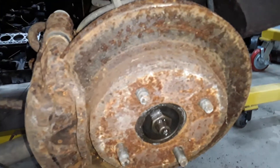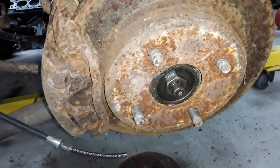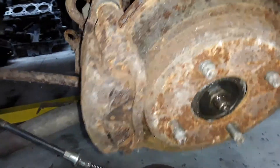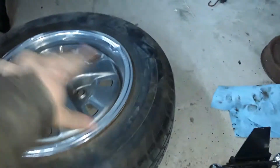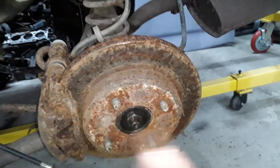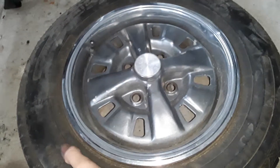What kind of wheels will this fit? From the center point to the outside of the caliper, it is six inches exactly. So that means the wheel's inside diameter can't be any less than 12 inches — full diameter from side to side. So these 13-inch stock steelies actually won't work at all.